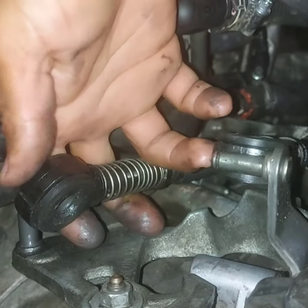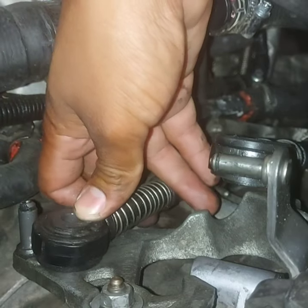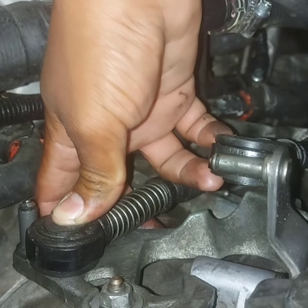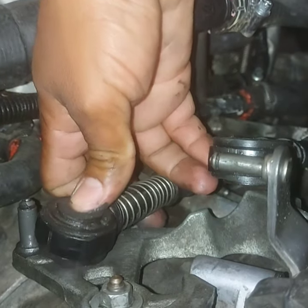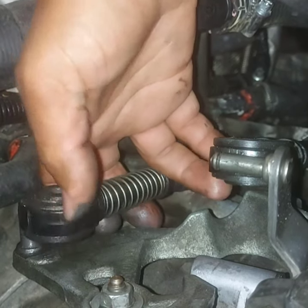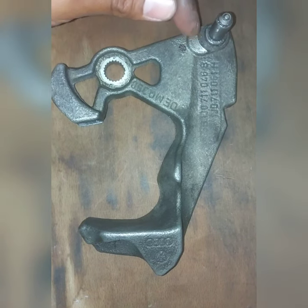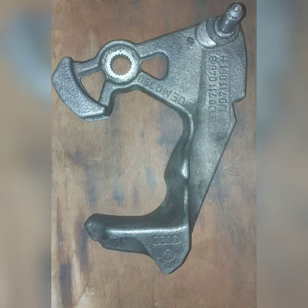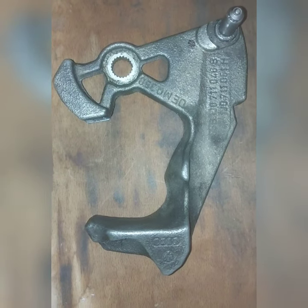Stay tuned guys, let's get to the fun bit which should help us with our throw. I've been checking online seeing what some other guys have been doing, and apparently if you shift this linkage over a bit you will have a bit of a shorter throw. I haven't been able to follow the other guys fully to see if they had much success, but I can imagine this might get in the way here. So we're gonna try and shift this linkage over to this side. I've made my little mark over there, I'm gonna drill a little hole through there and put a bolt and nut through it. Hopefully just with drilling that we can see some improvements.